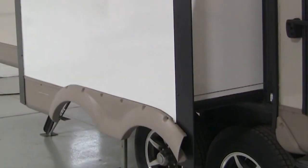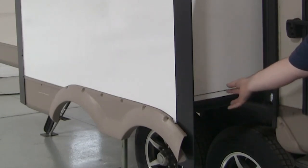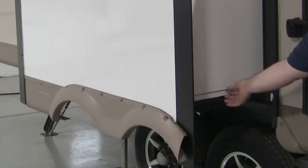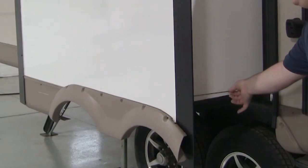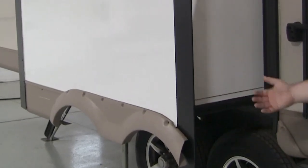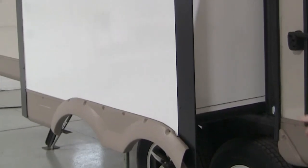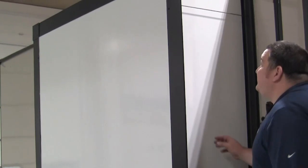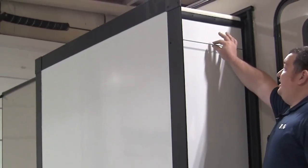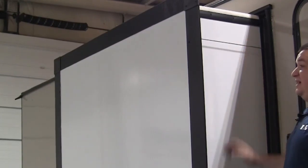The second thing we're going to check is exterior cable tension. The way we're going to do that is with these two fingers, we're going to grab the bottom cable. We should have a 1/4 of an inch deflection, meaning we should be able to easily lift it up a 1/4 of an inch, push it down a 1/4 of an inch from center. If the bottom cable is slightly tighter than that, it's perfectly normal because the bottom cables are what carry the load on this system. The exterior top, however, is going to be a 1/2 inch deflection. 1/2 inch up, 1/2 inch down from center.